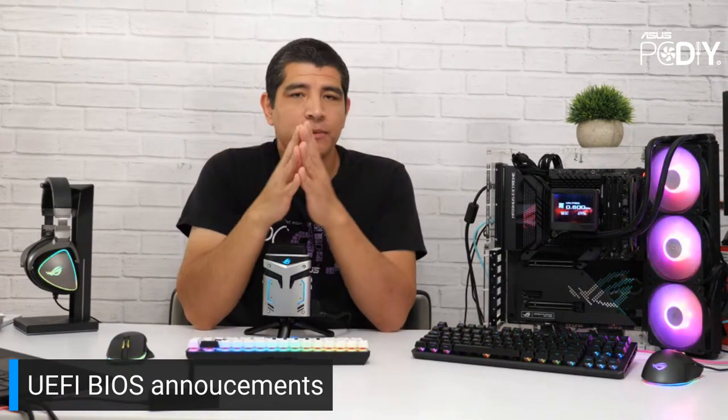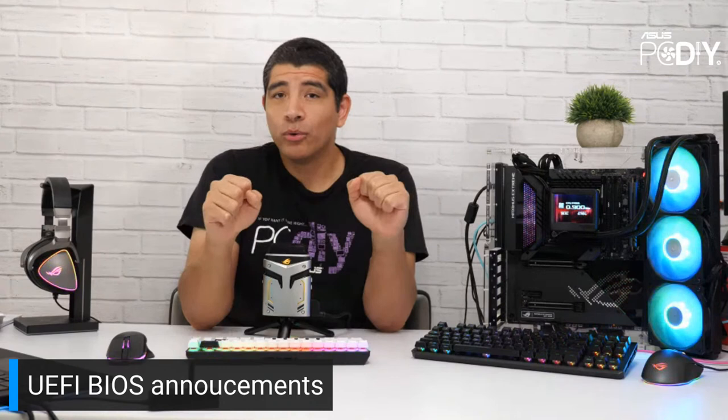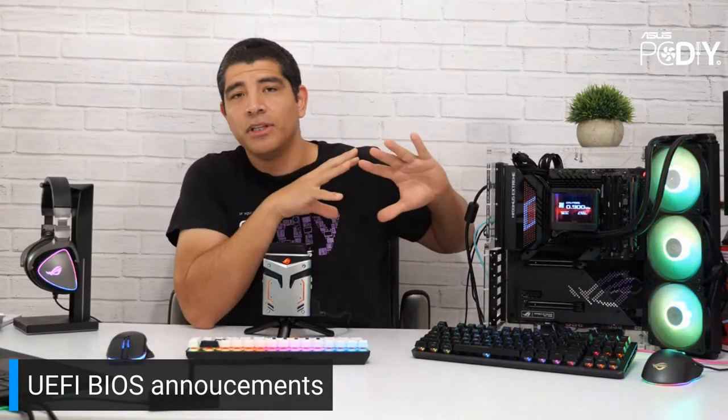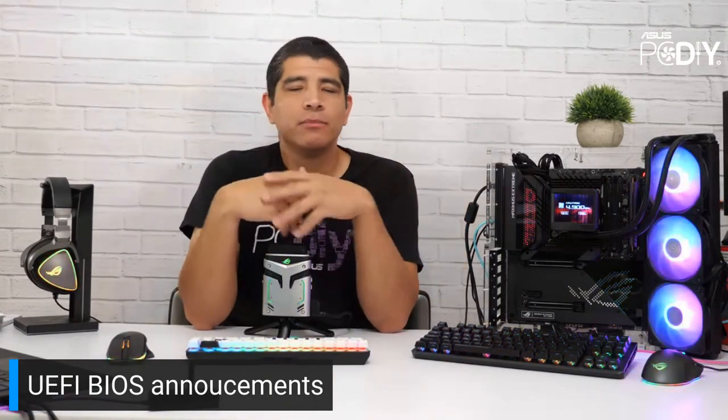Now, if you do update the firmware, my general recommendation would be after it completes, load your UEFI defaults, shut down the system, and perform what's called a cold reset. A cold reset essentially means unplug the physical power from your PSU, and let your system idle for about a minute or two. That's to let the system fully discharge. Plug that back in, load back into the operating system, load up Armoury Crate, and see if there's a corresponding update that needs to be completed, and then reset whatever your lighting profile should be, and you should be good to go. So that should get you covered in that regard.